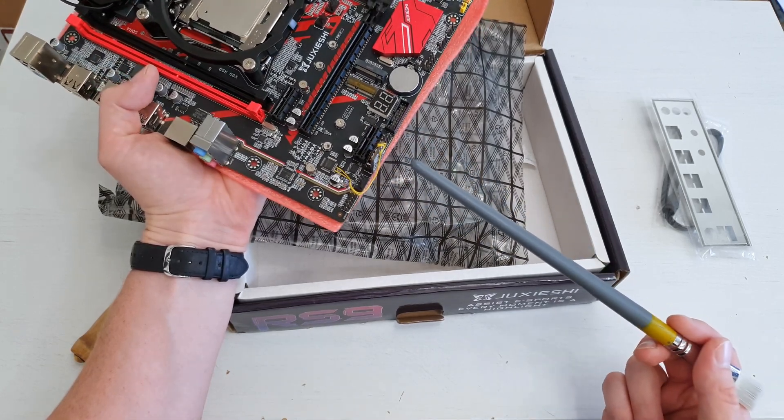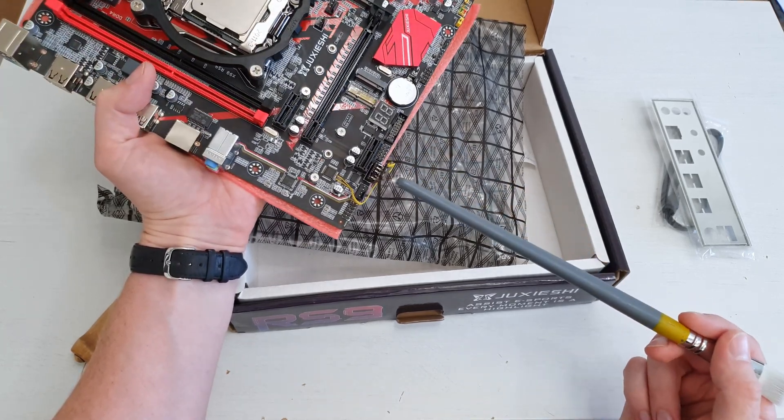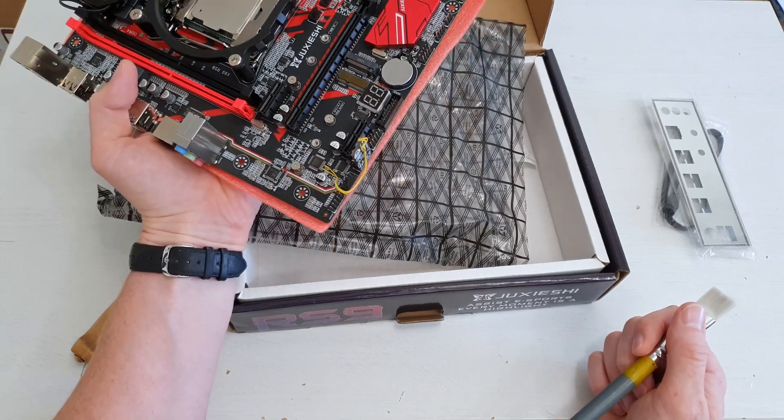but you need to power on and off your computer for it to properly function. If you restart your computer, the TPM is not getting reset and it will hang, and your computer will not detect the TPM 2.0 module.